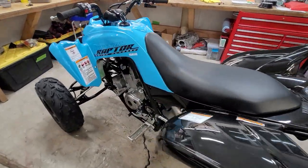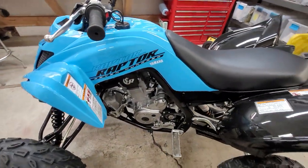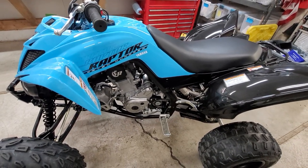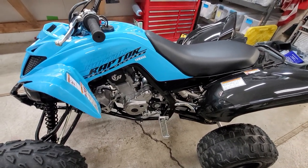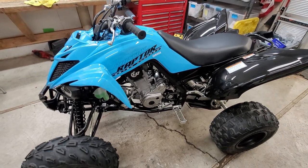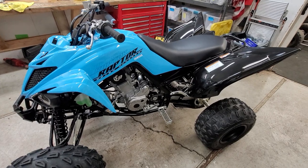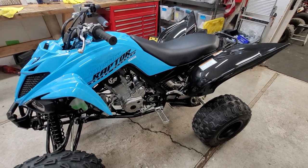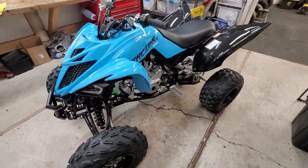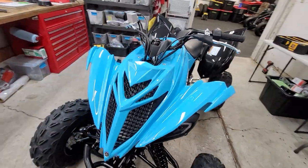So this particular motor, stock crankshaft, 14:1 compression, head package, bored throttle body, it's going to make in the 73 horsepower range, probably about 54 torque on E85. On 110, they're going to be very, very close to the same number. They come out very close to the same. So that is it for now.